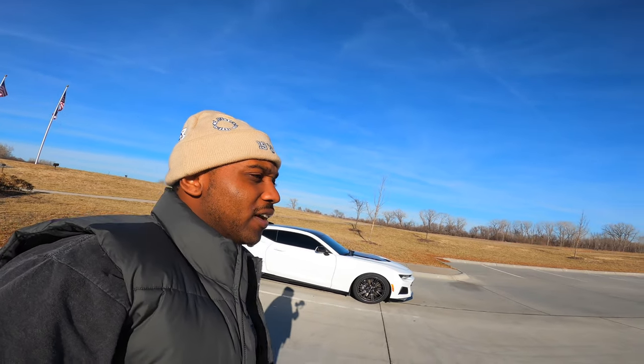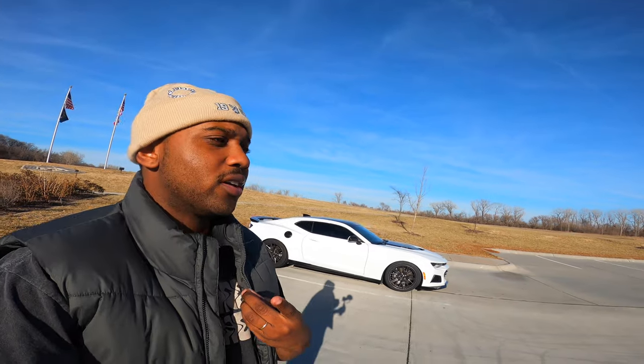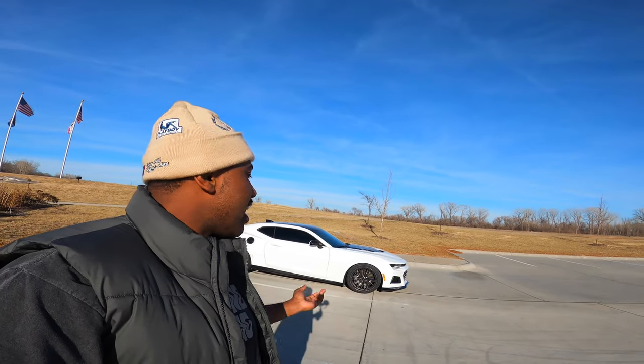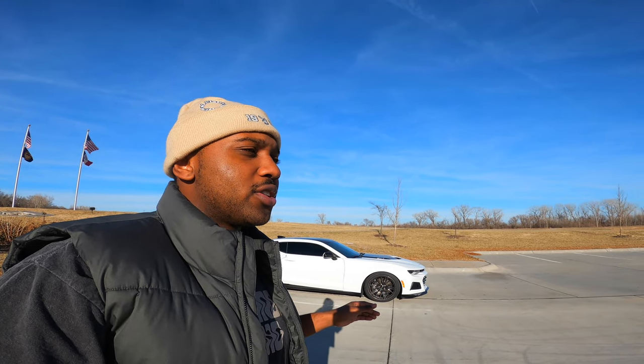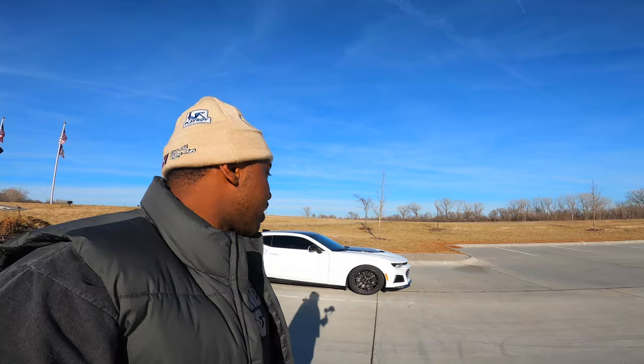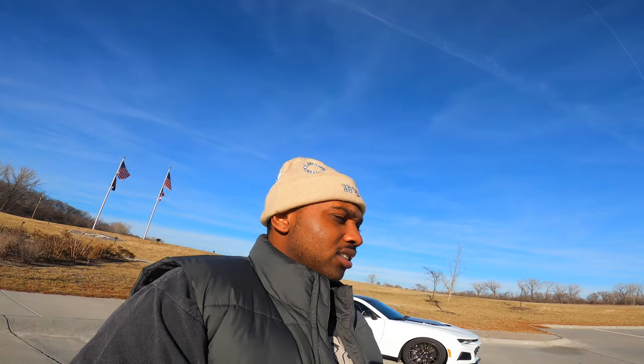headers, a little bit of E85, where you can go full E. You have to upgrade, either get an aux pump or get a big bore, a low side, high side, and injectors if you want to run full E. But E60, pretty sure you can do E60 with the stock stuff with no mods, or you can just add an auxiliary pump that goes from the actual gas tank to the engine. So that's cool to run E60, but headers, E60, pulleys.